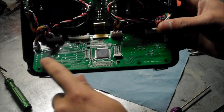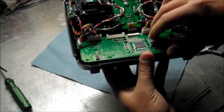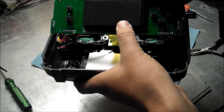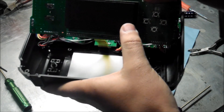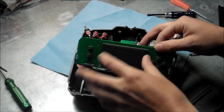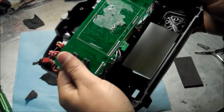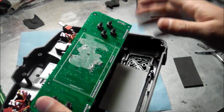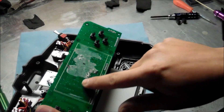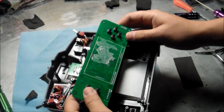Alright guys, once you've got the screws unscrewed from the board, you basically want to unscrew everything just so it lifts up like this. And here you see your backlight. And there's a foam — you're going to want to remove this foam right here, this whole thing. So just be careful when you're doing that. Once you take your foam out, it'll look like this. Taking it out was a little hard, so what I did was I just got a blow dryer, just heated it all up, and it all came off easily. So that's something you can try if you're having a hard time.